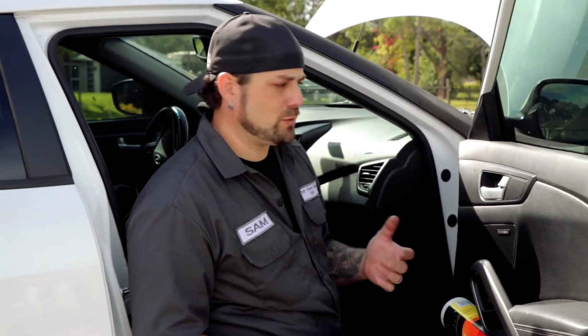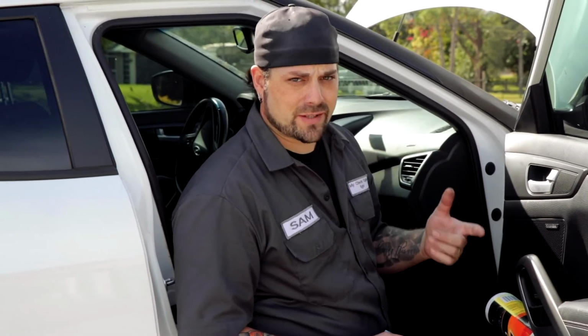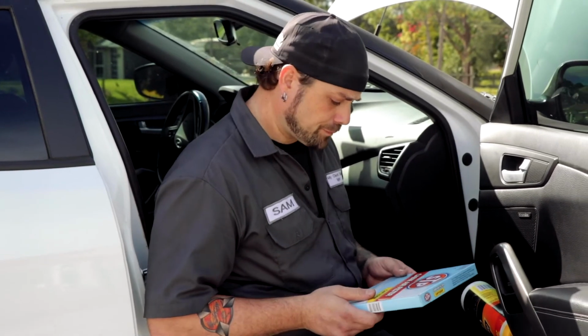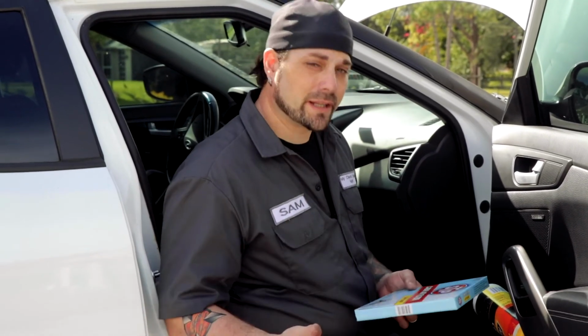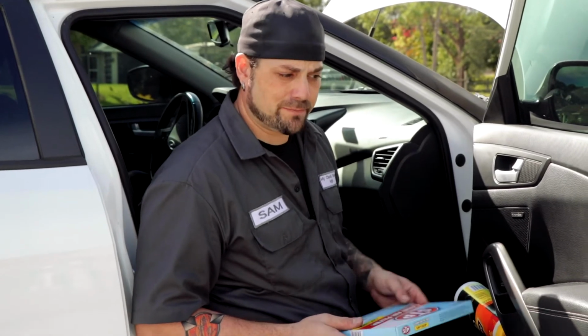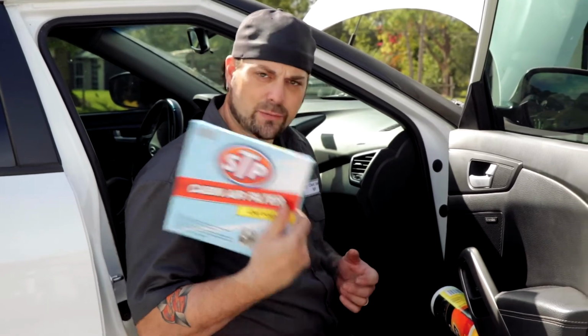And that becomes even more important because a lot of folks don't realize that when you have your air conditioning on and it's hot out, or if you live up north and it's cold, you have the recirc on. What that means is that all of the air inside of the car just recirculates inside of the car. For the AC, it helps it get colder. For the heat, obviously, it does the reverse. It's not completely sealed because of the airbags and things like that. It can't be a completely sealed vessel, but it does seal off relatively well. And so the air that comes in needs to be clean, right? That's where this guy comes in.